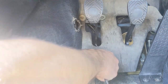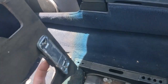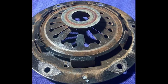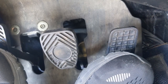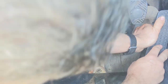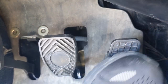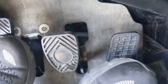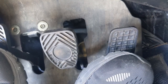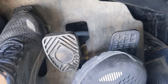The wooden pedal board is actually part of the clutch pedal adjustment because you don't want the clutch pedal to have too much travel. That can actually be hard on the pressure plate fingers, and it's possible to break the pressure plate springs or the fingers over repeated use and over time - they just get stressed out. The pedal board is now stopping the clutch from going any further down than right there.